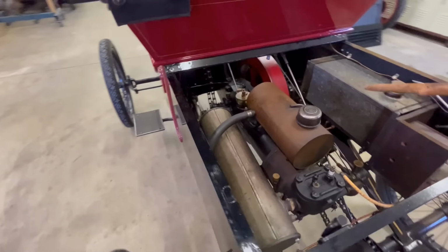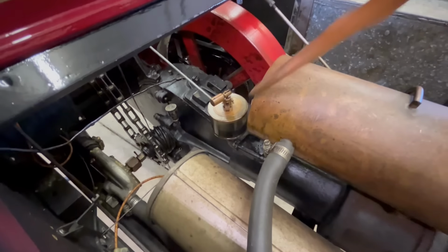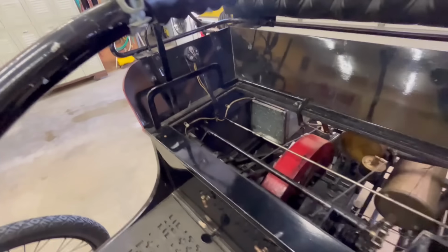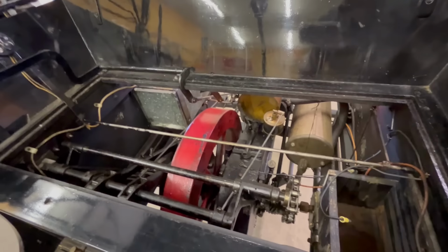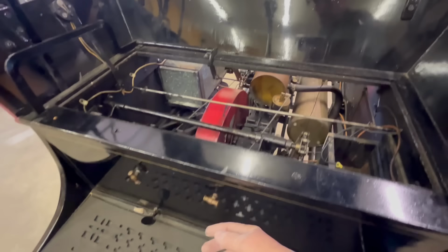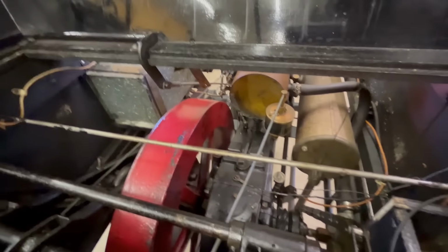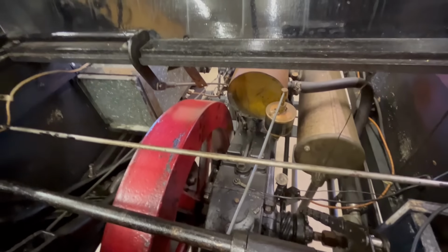first thing we're going to do is, if you see this little oiler thing here, most cars pre-1915 have oilers to oil different parts of the motor or chassis. This one has this, which actually goes right down into the cylinder wall. This is what's known as a lost oiling system. Basically, you feed oil into it all the time, and then it just blows it out wherever because there's no seals. So this is turned on from up out here. We're going to go ahead and turn this on because this is going to put some oil directly on the cylinder before I start turning it over and looking at it.